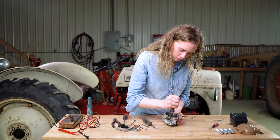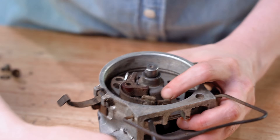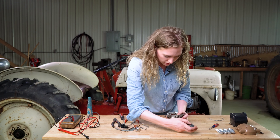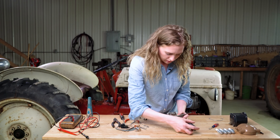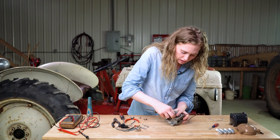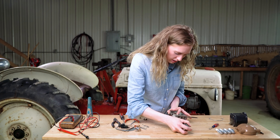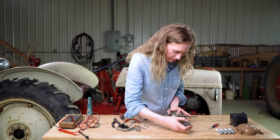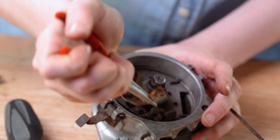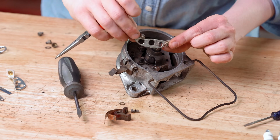It looks like I left one screw in — I forgot about that one. Let me reach in here. This one holds the very tip of the points on, so let me undo that real quick and then they'll come out. Because I pulled that out already, it's a little bit crooked inside there, so it's a little trickier to get removed, but we'll get it. There we go — you can see it's loose now. Then the points come out just like that. I'm going to pull this bottom plate out as well to disassemble that portion.